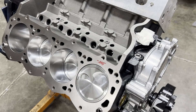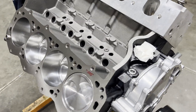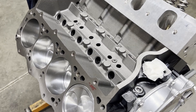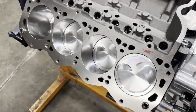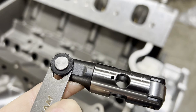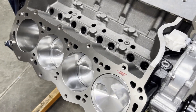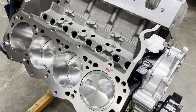If something happens after that, I know I did the best job I could. Stuff like this that I catch while the engine's being assembled, I want to fix right now. I'm actually waiting on FedEx to bring another oil pan gasket - I didn't have the one I wanted to use. So we're going to take this time to measure for our pushrods. Our BAM lifters came in and I've already notched the oil hole so they will oil properly - that's standard operating procedure for those and other brands as well.